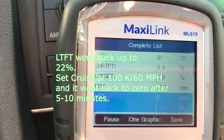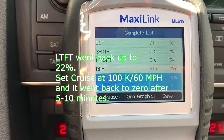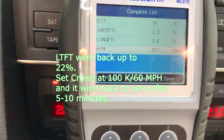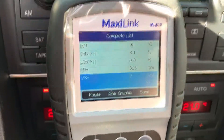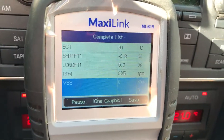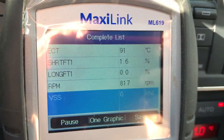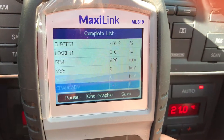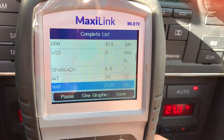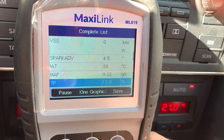Long range and short range looking good. So before you freak out, after you do your downpipe, make sure you take it for a long drive and let the ECM go through all the calculations at a few steady speeds — give it a chance instead of just flooring it all the time. This thing's getting about 12 to 13 psi boost stock with just the catalytic converter removed, and that's at 233k miles. So it's not exactly a tight engine — a newer engine would have more boost. I'm just learning this stuff for the first time. I sure hope this information helps while you're troubleshooting — just to get some idea of the values. It's running okay: when you floor it, it goes, it always starts, it doesn't stall. So hope this helps you out, bye-bye.